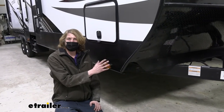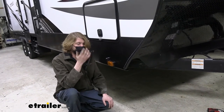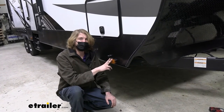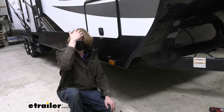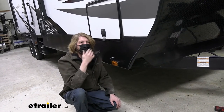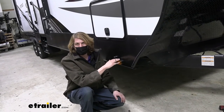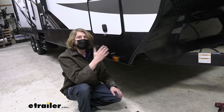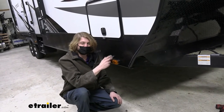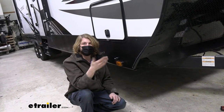Now, if you checked your lights at the beginning when we talked about checking them, and the function of this light ended up being a turn signal, I highly recommend to make it a running light the way we hooked it up. You can easily change that over. If you still want this light to blink as a turn signal, so it worked like it did before, then you would hook it to the power wire that's here. It would be a blinking power wire. And instead of hooking the camera to the light circuit, you'd actually hook the trigger wire to the light circuit. So that way the blinking signal would work your light as a blinker and would also trigger the camera that you've got your blinker on.